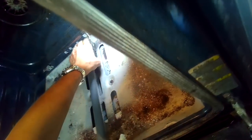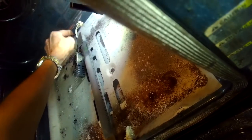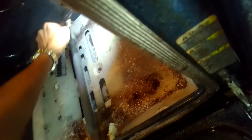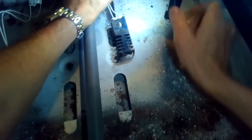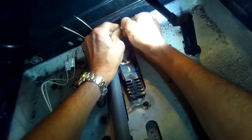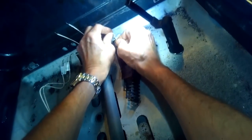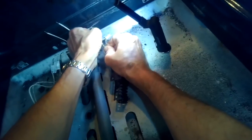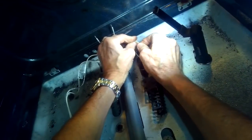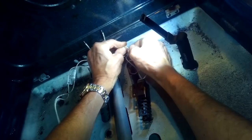I'm going to pull back on these wires. Sometimes you have to cut the wires, but this one just has wire nuts connecting it, so I'm going to undo the old wire nuts. That means this has been replaced since it was put in by the factory — from the factory there won't be wire nuts, it'll be a modular connector, or you may have to cut the wires. A lot of times igniter kits come with porcelain wire nuts that allow you to splice the old wires.